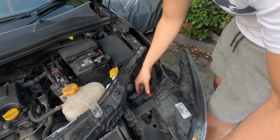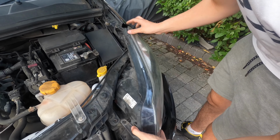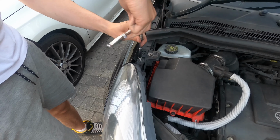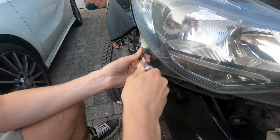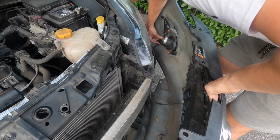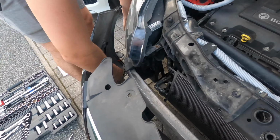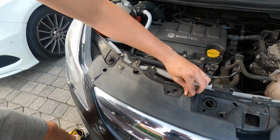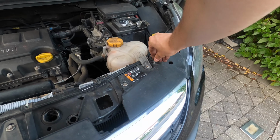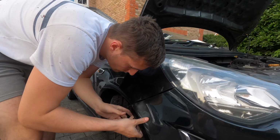So that's just the 3 bolts to start with on each headlight, and then you just have to reinstall your bumper and you are sorted. And don't forget to reattach those fog lights if you did disconnect them, because that would not be good. The only thing that is different to the uninstall is that to do the fender bolts, you need to click the bumper back in. When you see the bumper disconnected, you'll see where it's supposed to slot and you just pop it straight back in there and then do up the 2 fender bolts each side.